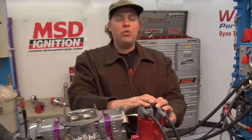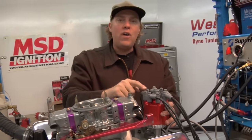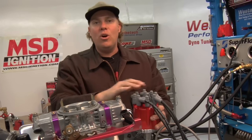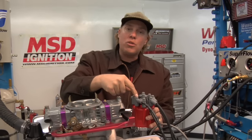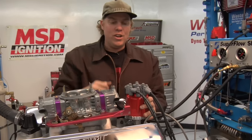I've cheated a bit here because we've pre-made our spark plug wires, but if I hadn't, what we would do is follow the firing order of the engine around the circumference of the cap. We know the Chevy rotates clockwise and we know the firing order, so we would start with one and then go eight, four, three, six, five, seven, two. There you go.